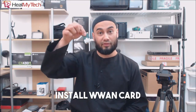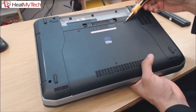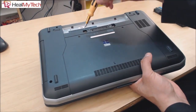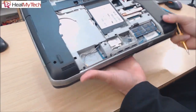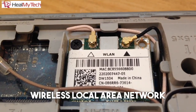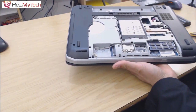Step two: we need to install the WWAN card. This is located behind the cover — again, consult your manual for your make and model. There are two screws holding the back cover; one of them may be hidden underneath a sticker. Use a small screwdriver and remove them, then pull out the back cover. This one here is the WLAN card, i.e. the wireless local area network card for all your Wi-Fi connections. This empty slot here is where the WWAN card that we bought needs to go.